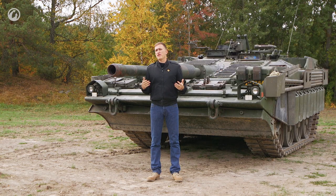Now, how is this revolutionary? Just look at the Sturmgeschütz — same idea. Well, the difference lies with the automatic loader. One of the big problems with having a four-man crew is that you've got to have room for that loader, which means more volume inside the tank. More volume means a bigger tank to protect that volume, which means you need more weight of metal to protect it for the same level of protection.